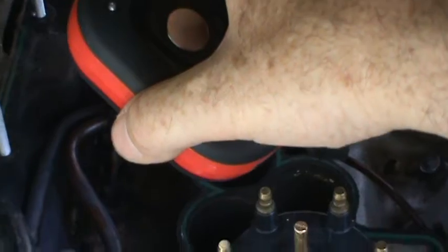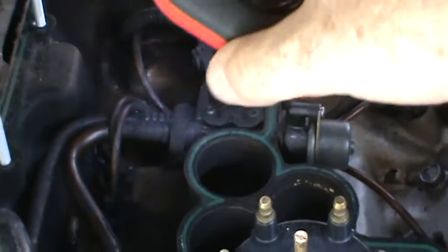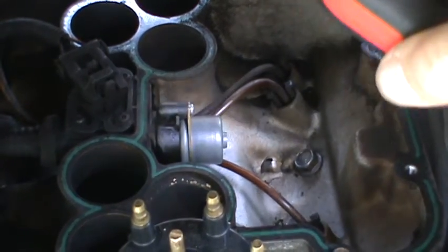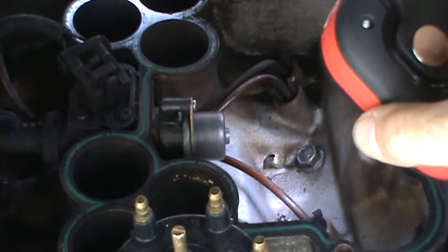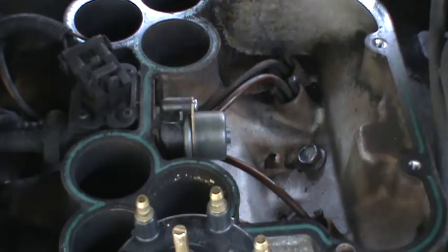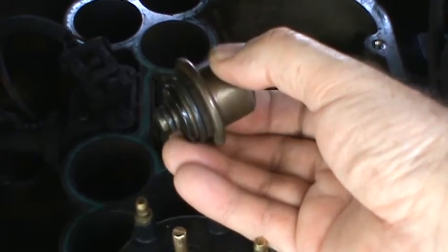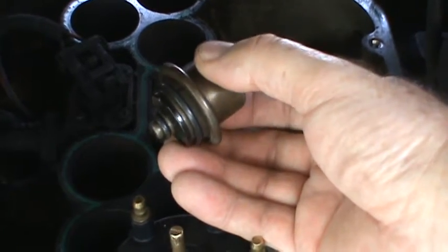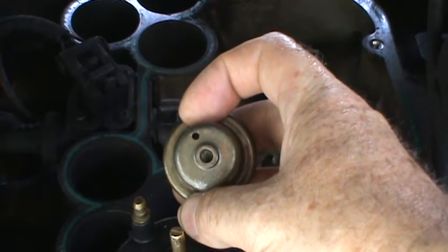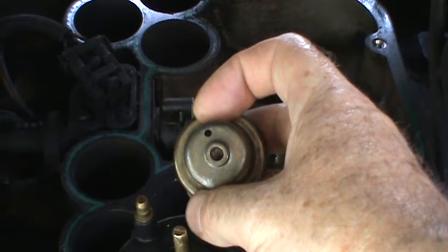I'm not really sure why there's any shiny down on that side. It's been sitting out here during the cold months, so it could be a bit of condensation acting on that side. But you can definitely see the big wash of aluminum all polished up nice and shiny - that's due to a fuel leak. Here's what the fuel pressure regulator looks like; it's got a filter screen and a couple of O-rings on it. This is the old one, probably an original GM one. There's a little hole in the end - it's subject to manifold vacuum when the engine is operating.